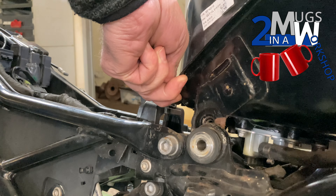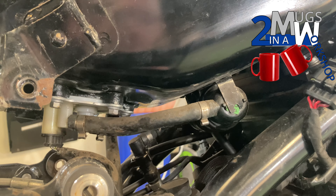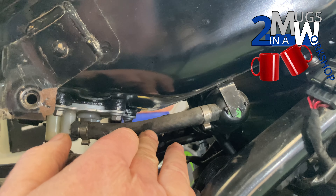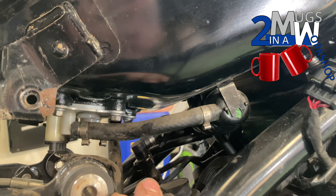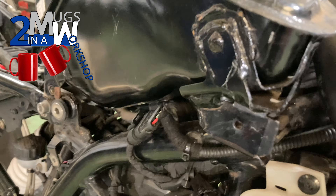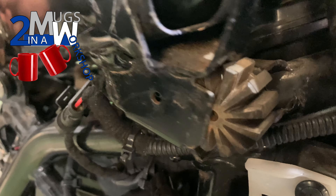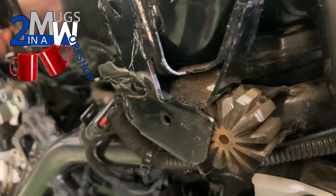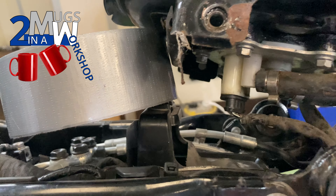You can see how the tank lifts out. As I lift it off, you can see all of the fuel supply pipes underneath. If you see this canister where my finger is — with the green sticker on the end — that is the fuel filter. So it's just a matter of removing the tank and somehow getting all these pipes off without a fuel spillage everywhere. I've gone handheld with the camera. As I lift it away you can see there's a big rubber lug — the tank just slides over those, very easy to come off. The tank literally slides backwards towards the rear of the bike and off it comes.